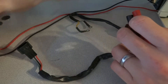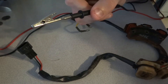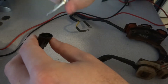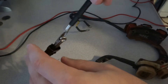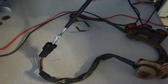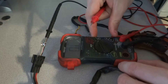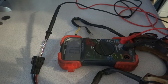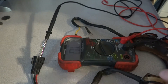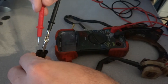I've got a little alligator clip on the negative lead and I'm just going to clip that onto the black wire — the black pin — just to make it easier. Now the black wire is on the negative lead, and I'm going to take the positive lead and place it on whatever I'm trying to get a reading on. Let's go blue first. Blue is supposed to be around 3000 ohms and corresponds to the larger of the two coils, so let's get to it.